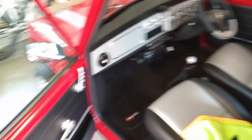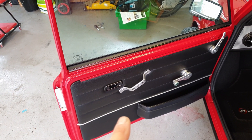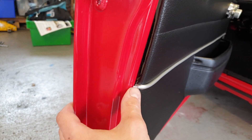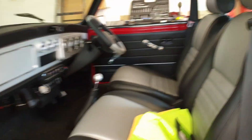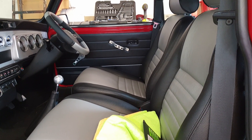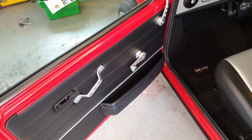On the inside, I've got a handbrake gaiter going on from Newton Commercial. The door cards unfortunately — they look very nice on the outside but water has got into them. I haven't got a membrane behind them, only a bit of tape, so on the other side they've gone pretty rotten. These are coming off and I've got a new set from Newton Commercial. John who made these did say I needed to put a membrane behind them. If you're looking for an interior, especially Cooper Sport ones, look at JCS Custom Trims — I'll put a link in the description.